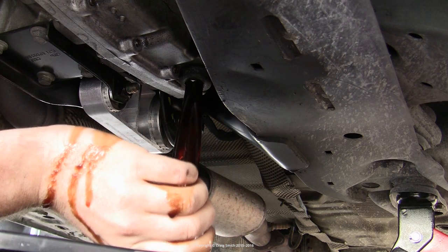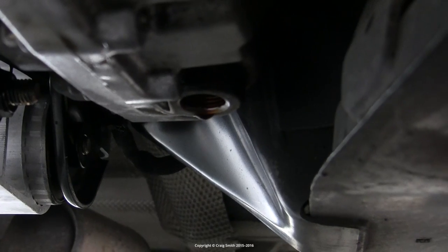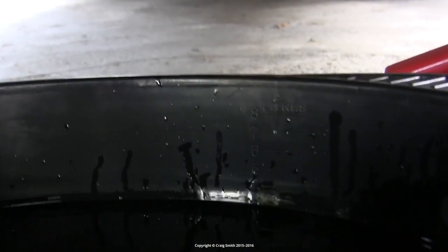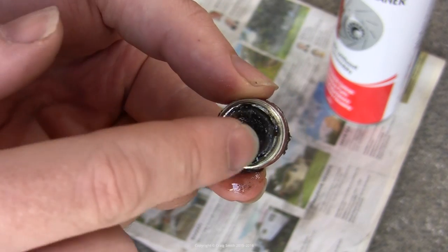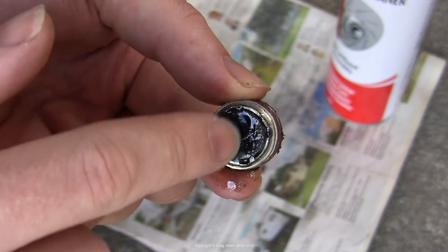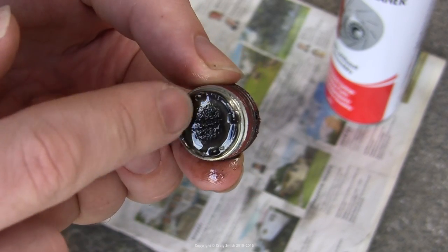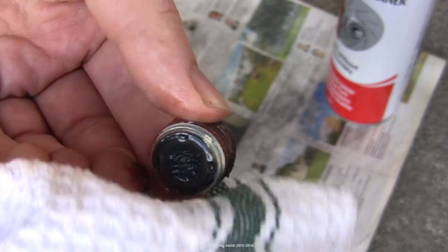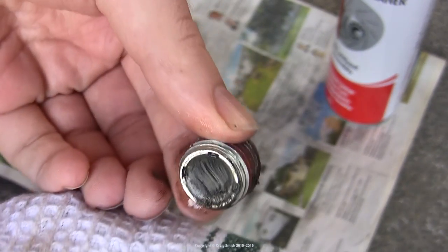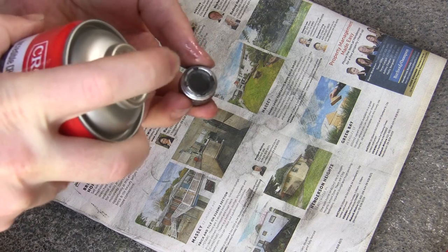You should expect to get about 3 litres or 3 quarts out immediately as you drain it. If you're able to leave the car set for any length of time — overnight, for example — then you should expect to get quite a bit more out. Now is a good opportunity to take that drain plug to one side, get it under some good light, and inspect it for any problems with your transmission. It is a magnet, and if there are lots of worn bits of metal or metal shards, that would indicate serious wear in the gearbox. In this case there's a bit of sludge, which is still wear, but it's not very bad at all — this looks pretty good.